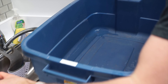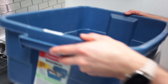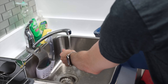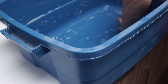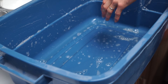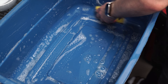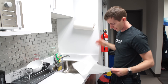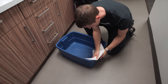Step 4: it's time to prepare two basins — one for rocks and accessories, and the other to capture the rest of the oil from the machine. If you're going to reuse the oil like me, it's a really good idea at this point to clean out the container before pouring oil into it. Mineral oil is a great cleaner and solvent in and of itself and will pick up all kinds of dust and grime from anything it touches, so unless you want that junk floating around in front of your video card, do a really good job of this.